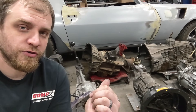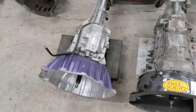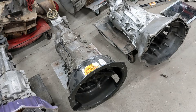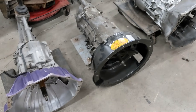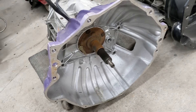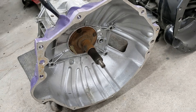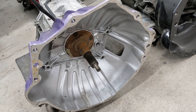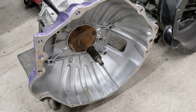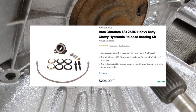Let's start with the two-wheel drive transmissions. These car transmissions are all 27-spline or 26-spline input shaft, 27-spline output shaft — all that stuff is interchangeable. This T5 here has an old big block bell housing on it, and that's the key to making it work with an LS. You need the big block bell housing because you need the 12-inch flywheel — the 168-tooth 12-inch flywheel. You can get a big block clutch, use the hydraulic throwout bearing; there are retro kits where you just put one stud in.